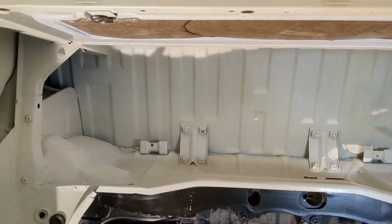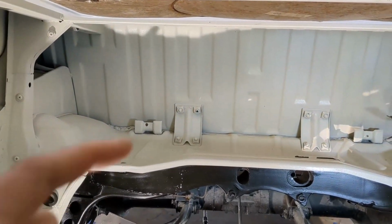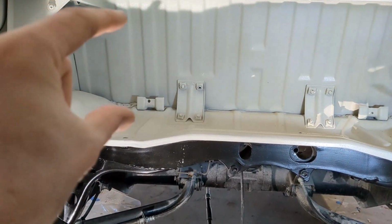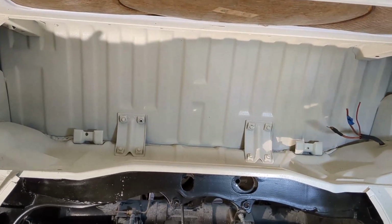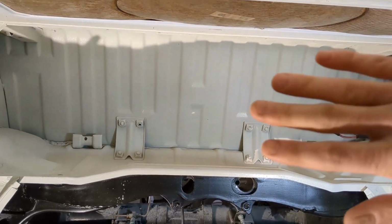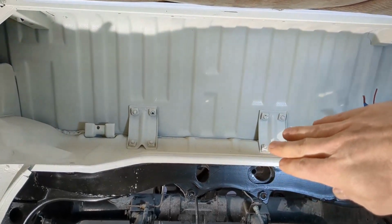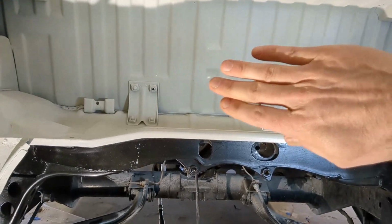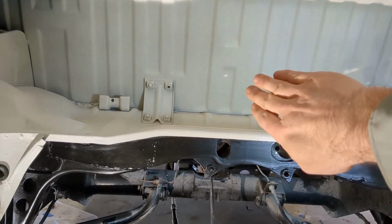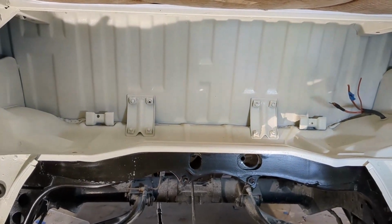So what I'm thinking to do is I'm not going to use that sheet metal panel. What I'm going to do is build a galvanized steel framing that's going to go across here, but it's going to be inset, because the controller itself is about 5 inches tall, so if it hangs vertically, it's going to have 5 inches of depth. And what I want is for it to be kind of flush with where that panel would be, but I need the framing that it mounts to about 5 inches in at least. So that's kind of where I'm going with that.